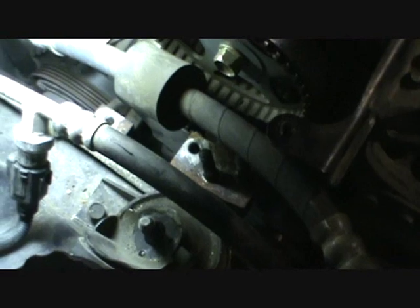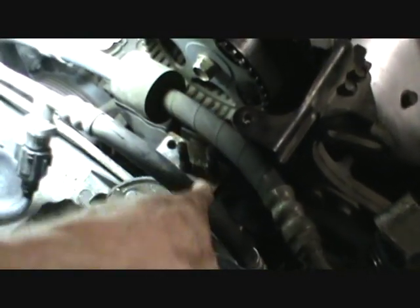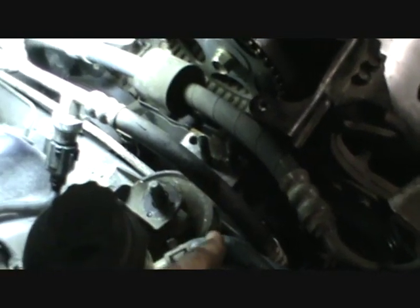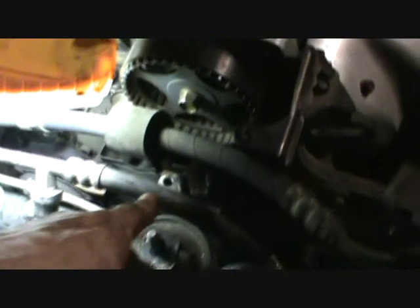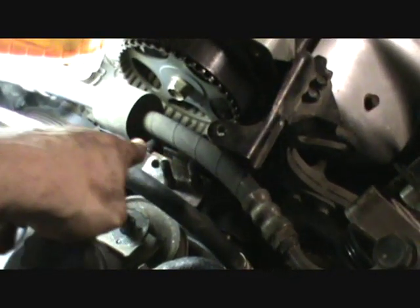Now something I forgot to mention here. You need to go ahead and remove this motor mount since you have the engine jacked up right here to get into everything. I'm going to put this in the description first, so everybody knows to go ahead and do that. But it's just 3 14mm fasteners and 1 17 over here.